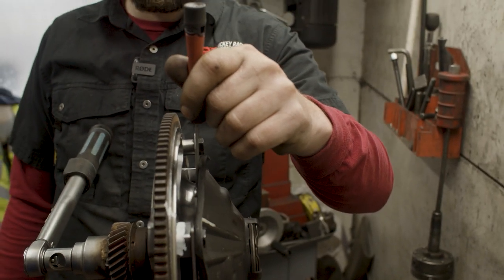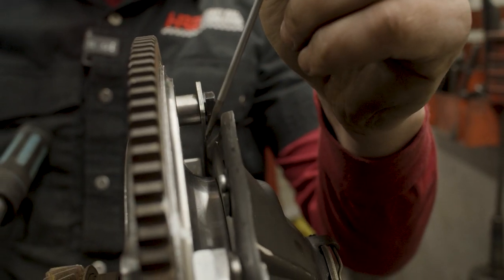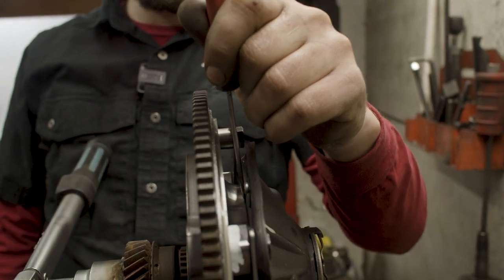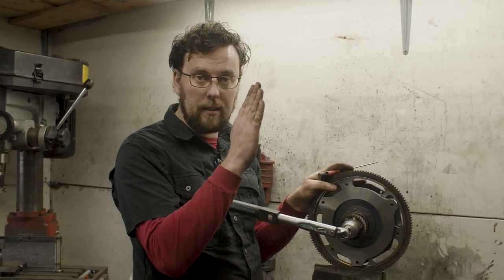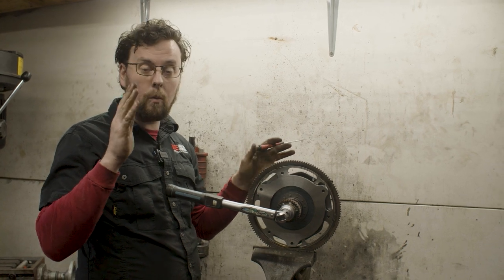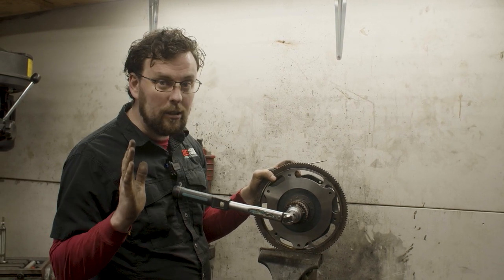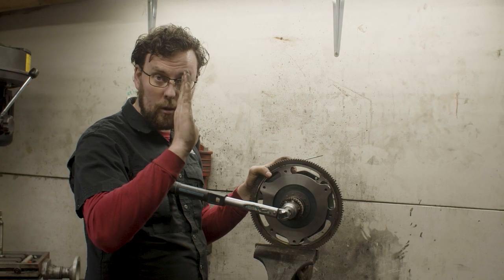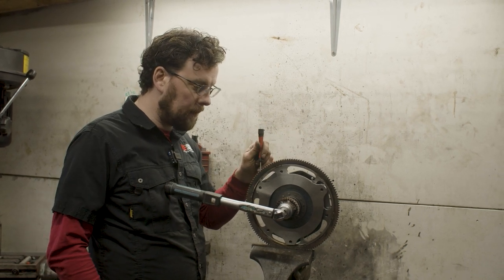It's not sitting parallel with the flywheel — I'll exaggerate it for you — it's sitting out at an angle like this. What I actually want is that diaphragm level, flat and parallel with the flywheel. That will increase the holding pressure on the clutch disc but it will also help us decrease the pedal pressure. Right now to release this clutch we have to increase the pressure and then release it, because as we press the clutch pedal we're actually increasing the pressure on the clutch plate and then decreasing it. We don't want that — we want to be right at that teeter-top point, at full clamping force, and then when we press the clutch pedal we simply release it.